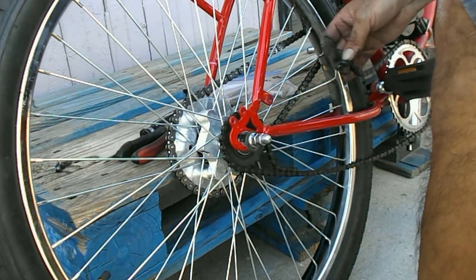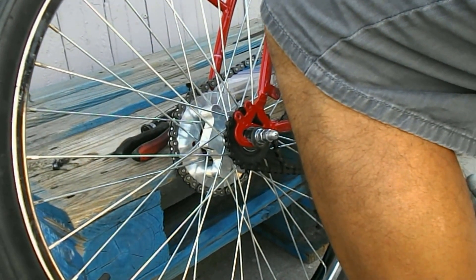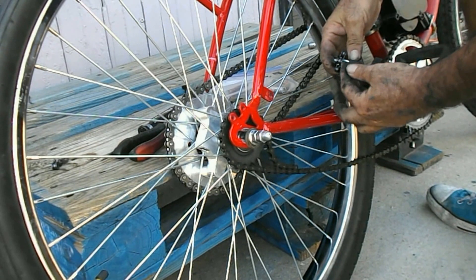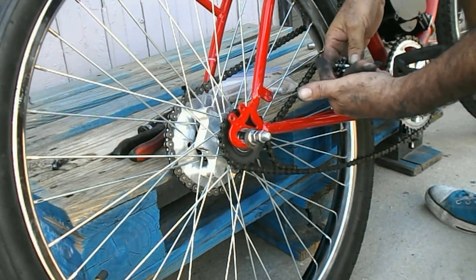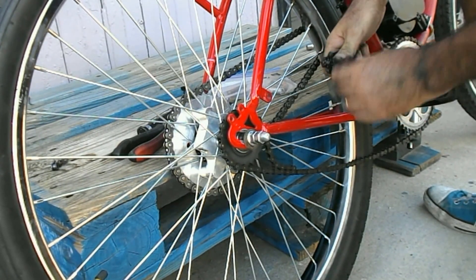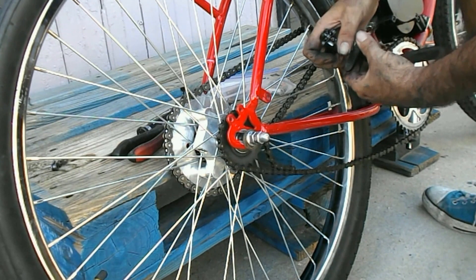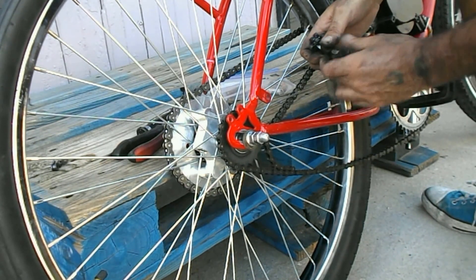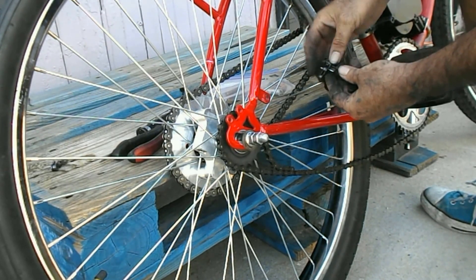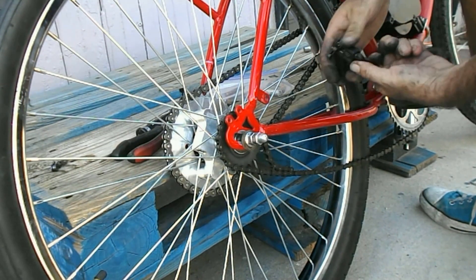So we're gonna cut right here. That's how I do it — there's a couple little teeth set up in the tool and you drop right down in there. One link of a chain is actually two pieces, so I'm only taking out a half right here. This one right here — see, that's the whole link, the two pieces. The chain is one link on these bike chains, motorcycle chains.